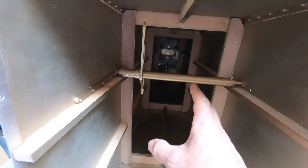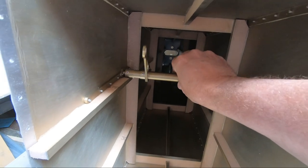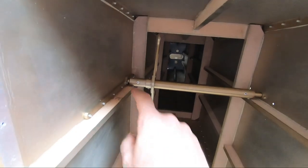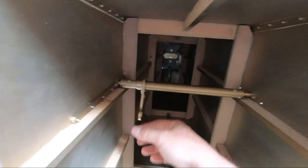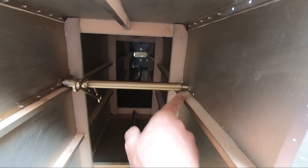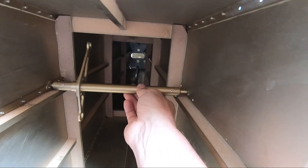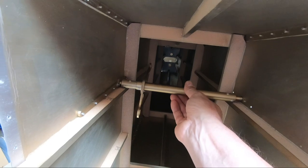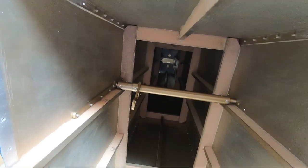I've got everything for the most part done now, though I am having a couple of issues. The tube itself doesn't rub at all, however the rivet on the bottom does hit the foam — it kind of brushes against it — and the rivet up at the top actually hits the aluminum edge on this lower stiffener. I'm just going to take a little file and notch a small spot out there to make sure the rivet head clears, and take a tiny bit of foam out to make sure that doesn't rub, but the tube itself seems to have clearance and doesn't touch at all.